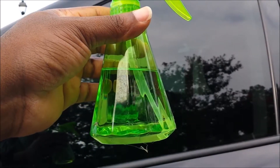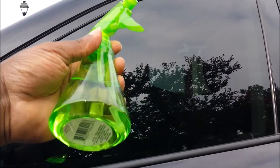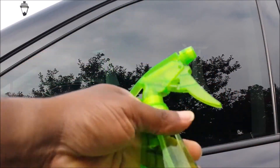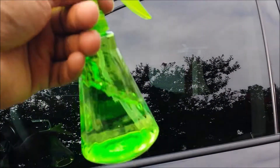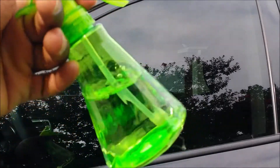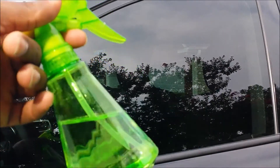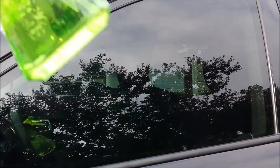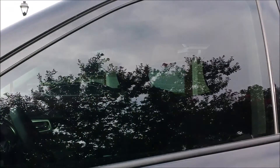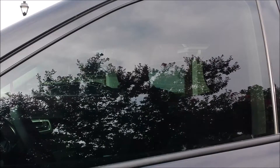The alcohol acts as the fighter to get the grime out, and it doesn't leave water spots — it works as a perfect solution especially in the sun since it dries really quickly. This is my go-to if I'm in the sun, if I'm detailing a customer's car and I don't have a garage or shade for the glass or the glass is really hot. Should be your go-to too unless you know another trick — let me know in the comments.